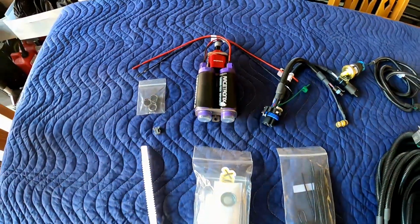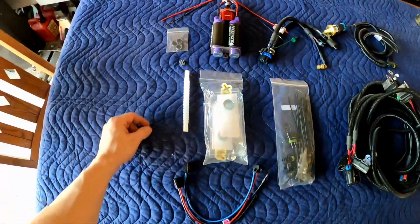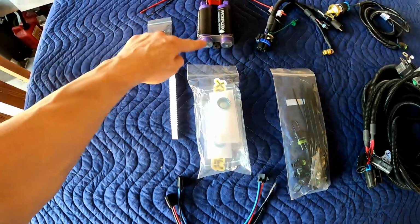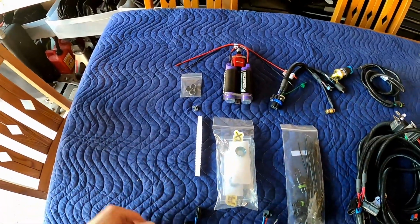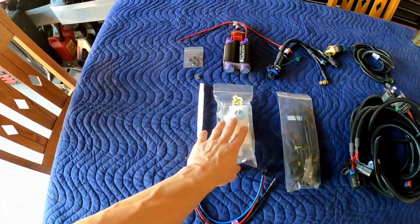Anyway, so the fuel pumps, we got the fuel socks that are going to be obviously going on the bottom here. Both of those are capped. Please make sure you guys keep those capped up until you're ready to use the fuel pump. This should be the last thing you prepare once your tank is opened, to make sure that you don't contaminate your fuel pumps or your filters.